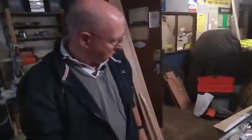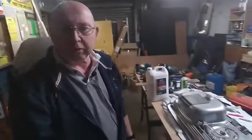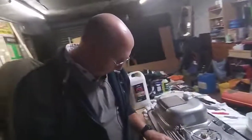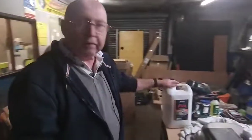Well, I've got the sink and hob unit down from upstairs. And I've spent the last 2 hours preparing it. Well, probably 1 hour of that was trying to find the screws, but I've had to scrape all the old sealer off and get all the edges nice and clean, and the new seal on. And I've decided to seal the edges of the work surface where the sink goes into. It was sealed when I originally fitted the sink, but I thought, why not when it's out?